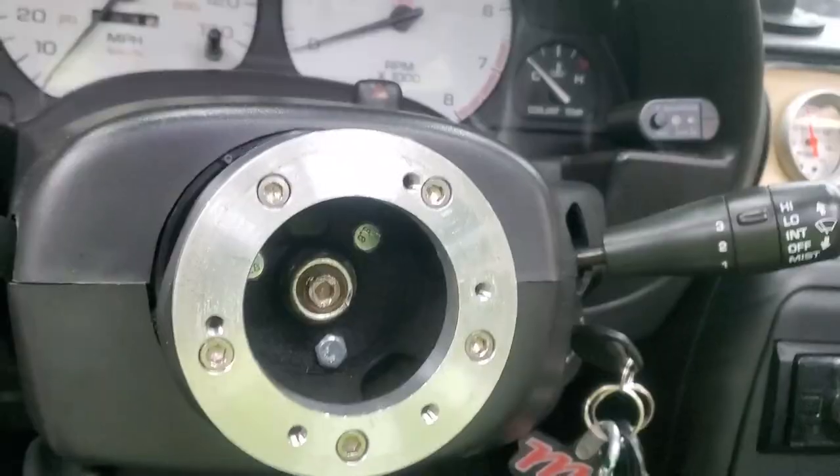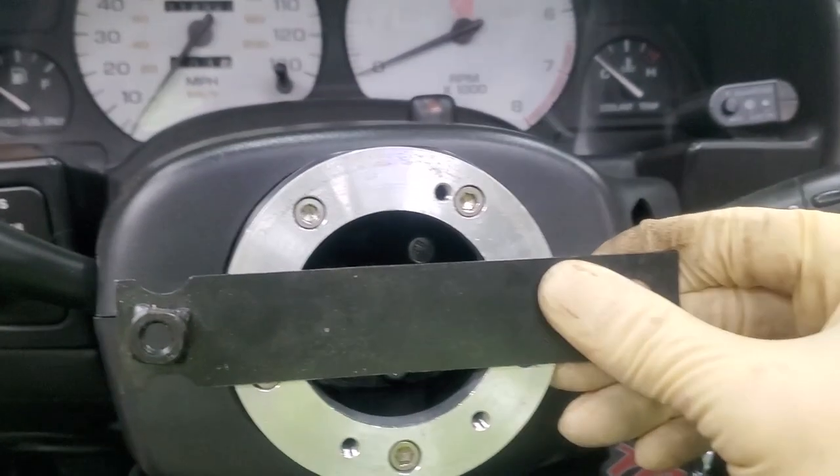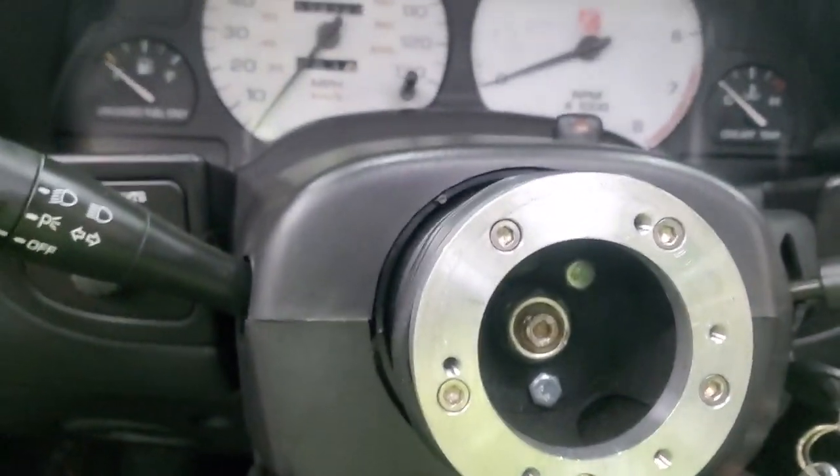I got the quick release off, now I'm down to the adapter. A normal steering wheel hub puller will not work — I've tried multiple times. So I'm going to make my own thing: I'll get the bolt off here, which is a 21, then make a plate, drill holes, bolt it on, and in the middle drill a hole and weld on a nut so it can hopefully push the hub right off. You guys will see on the GoPro whether or not it works.